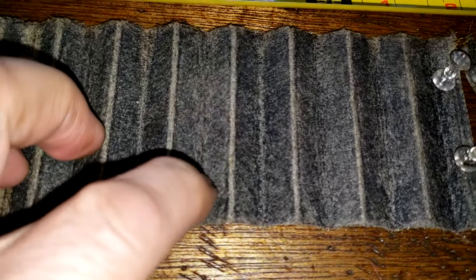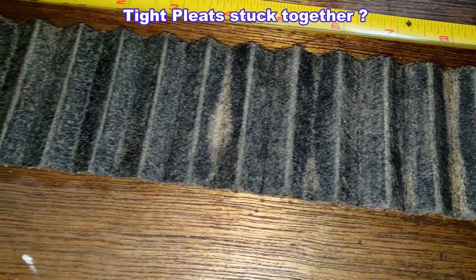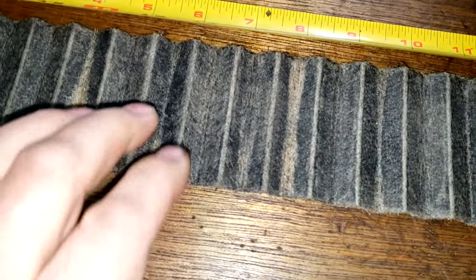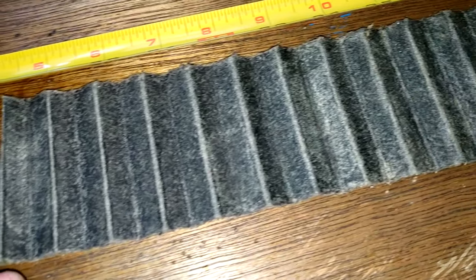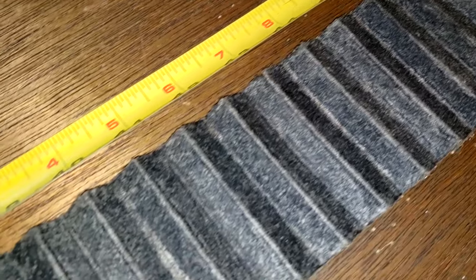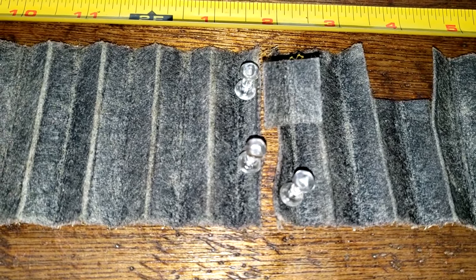There's not really any soot piled up on the outside — it's like it's inside the filter itself. I've seen this before — where the media fibers are stuck together, you get some non-filtering in those little spots. But overall, there's really not much soot on the outside itself; it's just all inside. There are a couple of little sparklies right there, but not much. I think the filter actually did a pretty good job, because it's all stuck inside the filter media itself.